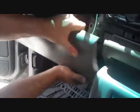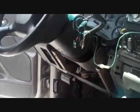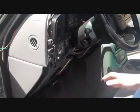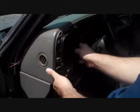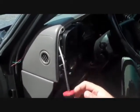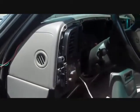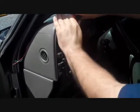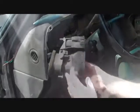There are two clips, one on the left and one on the right. After we remove this panel we can set it aside. The next thing we need to do is remove the headlight switch housing out of the vehicle by pulling on it — it has some clips in it. If you have problems with a clip, you can use a pick tool to go in behind the clip and pop it out. There are actually four clips holding it in, one of which is inside a hole. Once we have that out we can pull it out and lay it to the side.